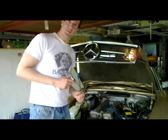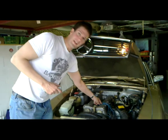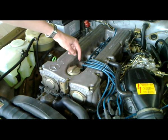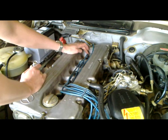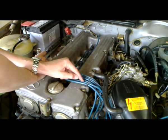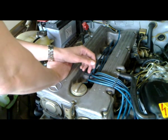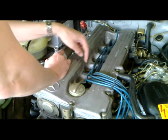Now we are going to prepare to open the case of the engine. This requires first of all removing the cables which go to the ignition plugs. Something very important is that you remember which cable goes into which plug — they are numbered: 1, 2, 3, 4, 5. For the 6th one we will not remove it, so it only requires removing the first 5. I would suggest that you write small numbers on those cables so you don't confuse them, because if the wrong ignition plug is fired at the wrong time your engine will never work properly again.